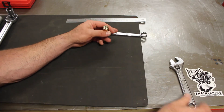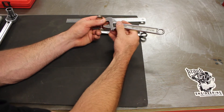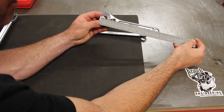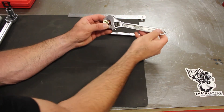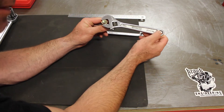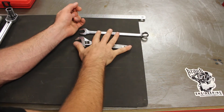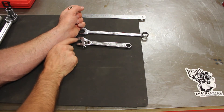So if you have a shorter lever — here's a standard adjustable wrench — this lever might only be, let's say, 200 millimeters, which is 0.2 of a meter. If I still wanted to achieve 2.5 Newton meters, I'd need to apply a larger force at this end because the lever arm is shorter. So I need to apply more force to get the same torque at this point.